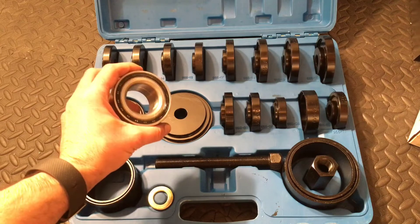Once we get it all the way in, we can take our retainer ring and go ahead and put that ring right here on the outside of the bearing, locking it in from coming out in this direction. Then we can start putting a little bit of grease on the hub shaft and press that into the inner part of the inner race. And that will wrap this up.